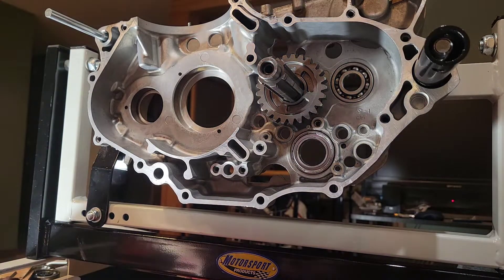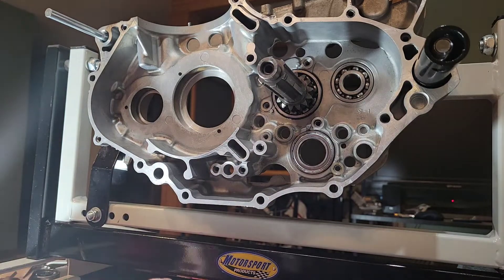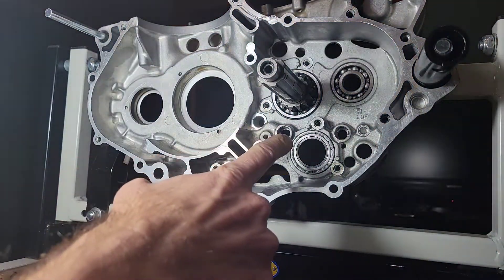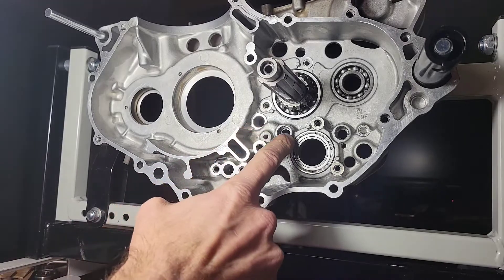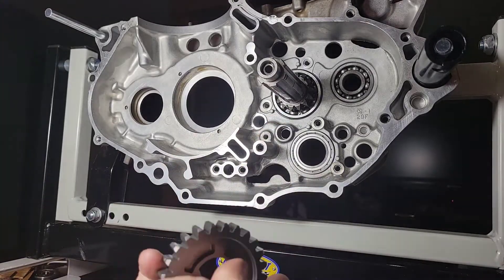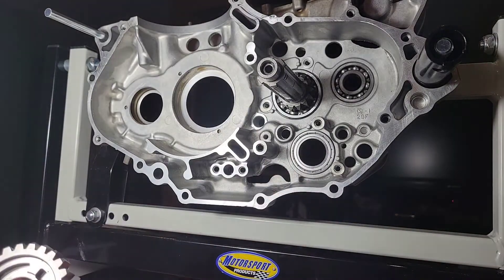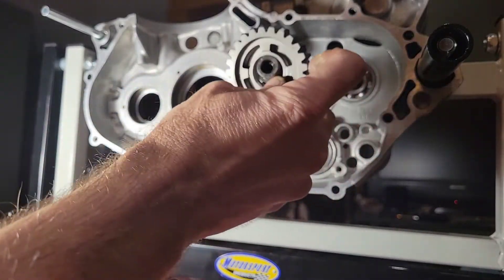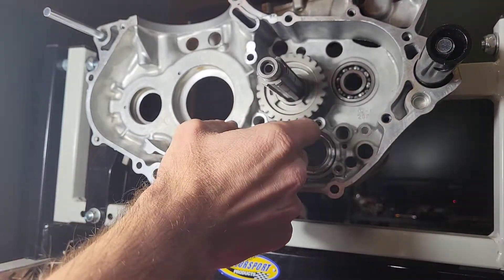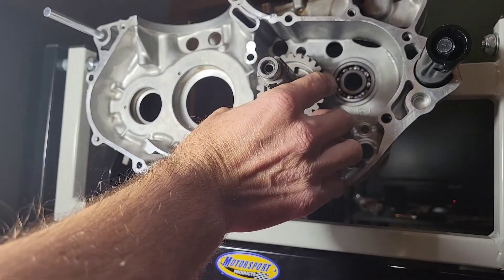This is just me sharing my experience. Here is the transmission main shaft, and I'm going to get my light over here to show where I've clearanced the cases. You can see that's an out-of-round area — I had to remove that material because the fifth gear is so much bigger that it runs into interference there. I'm not a perfect mechanic, so I may have removed a little more material than needed, but enough that this spins freely.